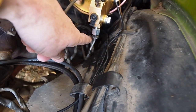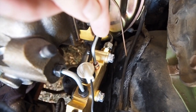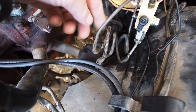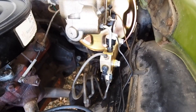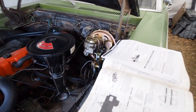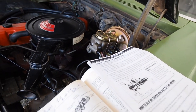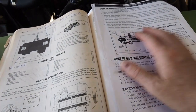Once you buy those two adapters it's very simple. There's the front adapter and there's the rear adapter — there's enough coil in the front and rear brake line to unbend it slightly and get it into the proportional valve. That's just a little tip on re-plumbing the power brake booster and master with the new proportional valve. They really don't tell you in the kit instructions that you need these adapters.